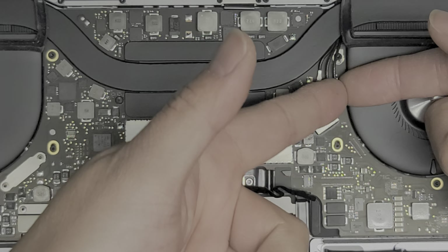I'm going to disconnect the battery, hold the power button to make sure power is drained from it, and then reassemble everything else. Peel this back up, flip the latch, pull the connector back out. Peel this back up and undo the T5 screw. Pull up the connector so it's not touching, then press and hold the power button for about 10 to 15 seconds.